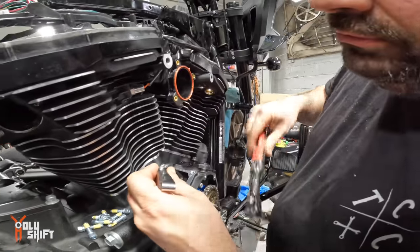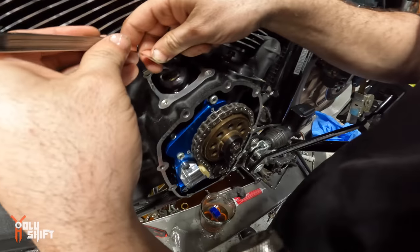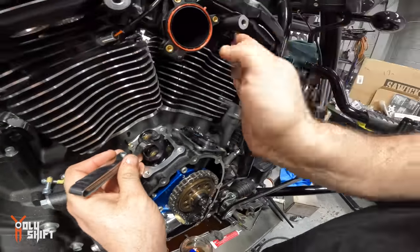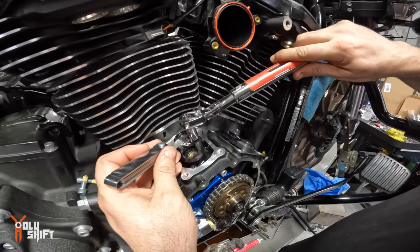Well, we're going to put a 2/1000 feeler gauge in here on the load side, so that when we tighten the screw, because it's going to rock that way as I tighten. So with the 2/1000 in there, it stops it just in time. Right, stop it.